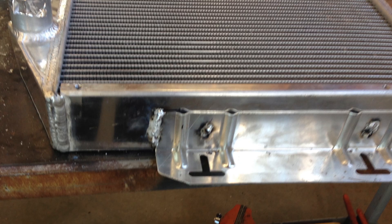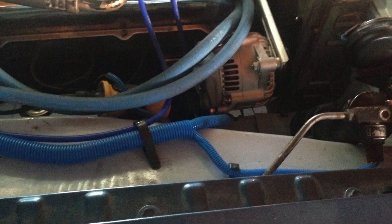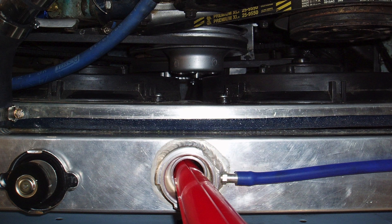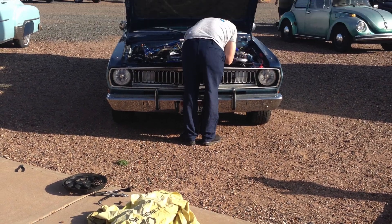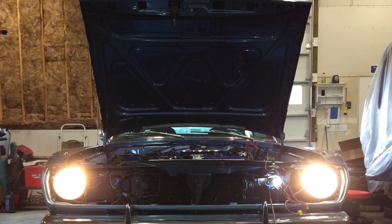There's a huge gap between the radiator and the front mounting support. Another downside is this radiator is for an E-body, so it's designed for a wider opening than this car has. I did not open that up because it would have required removing the air conditioning condenser, and I'm still running R12 in the AC system, so I have no intention to open that up until I have to.